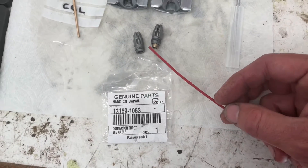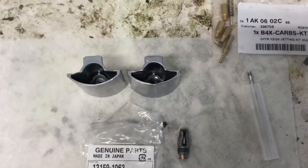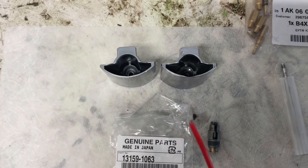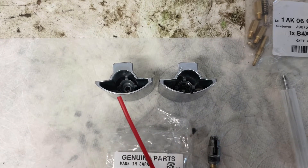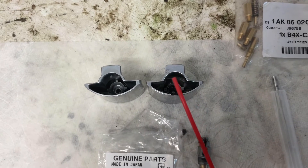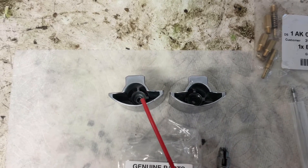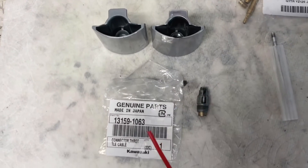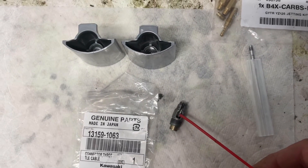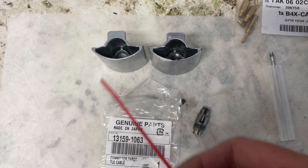The cable holder is readily available — there's a Kawasaki part number, and JD Jetting also makes one. The key thing: when you switch to non-Yamaha slides like the number six from Keihin, Kawasaki, or KTM, make sure you use the non-Yamaha cable holder. The Yamaha cable holder has a spring and an insert — do not use that cable holder with non-Yamaha slides or you will break needles.